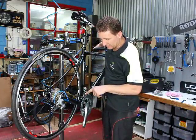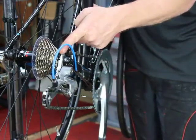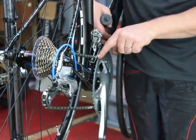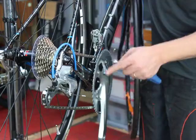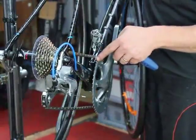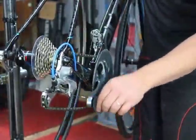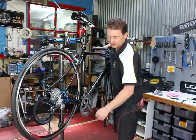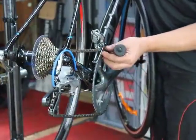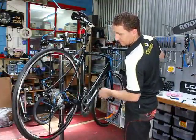The final check we need to do is the trim adjustment — the middle trim. When we're in the smallest cog on the front and the smallest on the back, which isn't ideal to ride in, the chain will be crossed up and will rub on the outside plate of the front derailleur. We need to make sure that with one click on the front derailleur it's a trim position — it moves across without wanting to put it up into the big ring. We can hear it rubbing on that front derailleur. One click over with the trim, adjusted by our cable adjusters on the frame. Just make sure it's not trying to jump up into the big cog, and then the second position puts it up into the big ring. Once that's done, we can pull our stickers off and we're good to go.